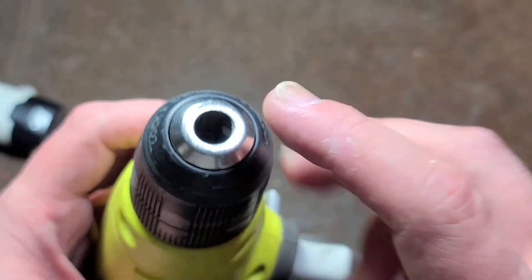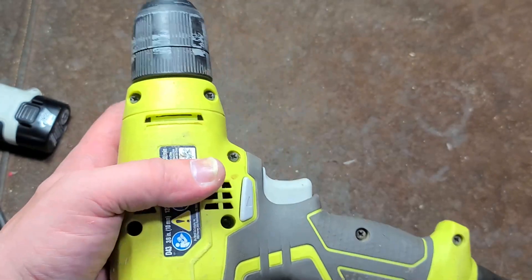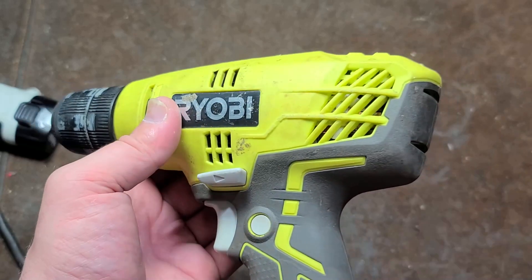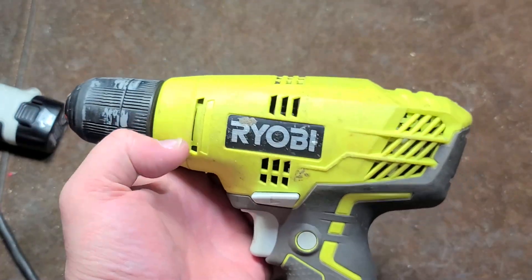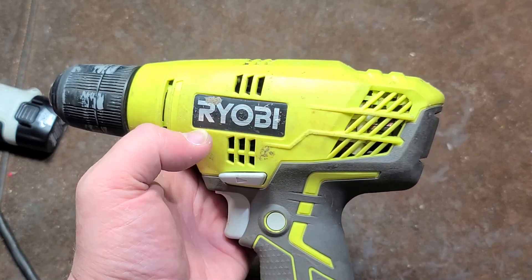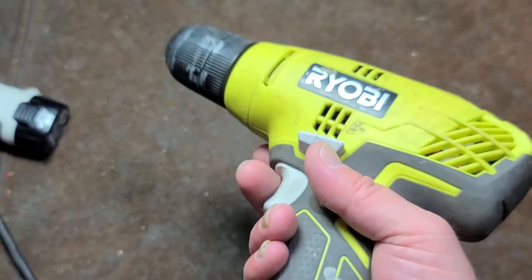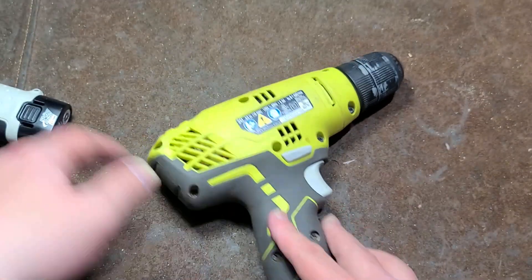The chuck does not have a lock screw and doesn't even have a threaded hole. They just basically torque the chuck on tight enough that it won't come loose even under most situations, even during heavy reversing operations. But using that planetary gearbox allows them to make it shorter, it has a really big fan that moves a lot of air, high speed motor, and it is compact and pretty lightweight. If they had a better spindle, this would be a really good homeowner's drill.